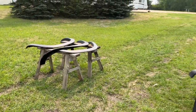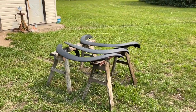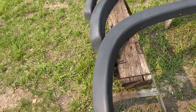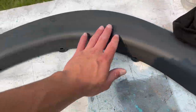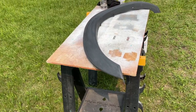So as you can see, we're continuing this video and there's no more snow on the ground — it's all nice and green, it's a nice summer day in May. We've got the flares out here at my grandparents' place, and today is paint day. I think I'm only gonna do the primer today because I'm still waiting on the call that my actual paint is ready. Everything's been sanded — I literally just did a nice light scuff on them to make sure the primer has something to bond to. I went 80 to 120 to 240 to 400 and then did a little wet sanding.